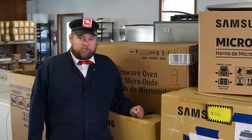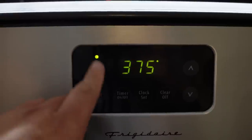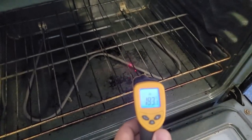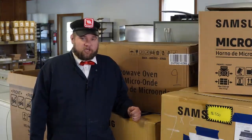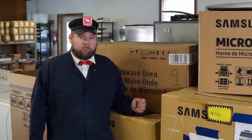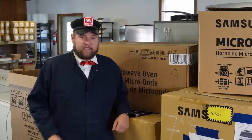If you can plug the stove in, turn the bake on primarily — usually the broil is okay, but the bake should be able to go up to 350 degrees Fahrenheit, which you can verify with a temperature gun. If it hovers around 200 to 250 degrees, chances are the control board is damaged and not providing the right power to the element, which can be an expensive fix. Same thing with the stovetop elements — make sure they turn on and can get hot, but also check that they cycle off. Sometimes an element can turn on but will run at max temperature and will not cycle off, which can also be a potentially expensive failure.